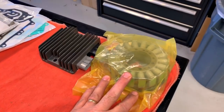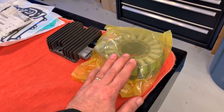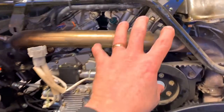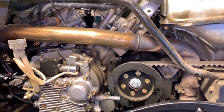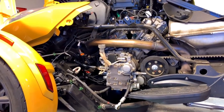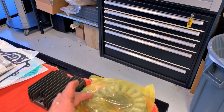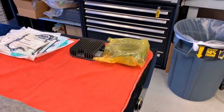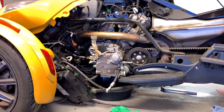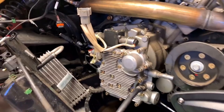These are battery maintainers — don't confuse these with a battery charger. It will charge the system, but it's basically meant to maintain it. If it has an alternator, like the 1330s have a 1250-watt automotive-style alternator, those you can charge a battery — if you have a dead battery, jump it and drive along, just like your car, and it will charge the battery. But this greatly overheats one of the phases. There are three phases in here and it will smoke them — maybe not right away, you might get lucky a time or two, but you've weakened the system. If you have a dead battery in a stator, which most motorcycles are, you need to charge that battery.